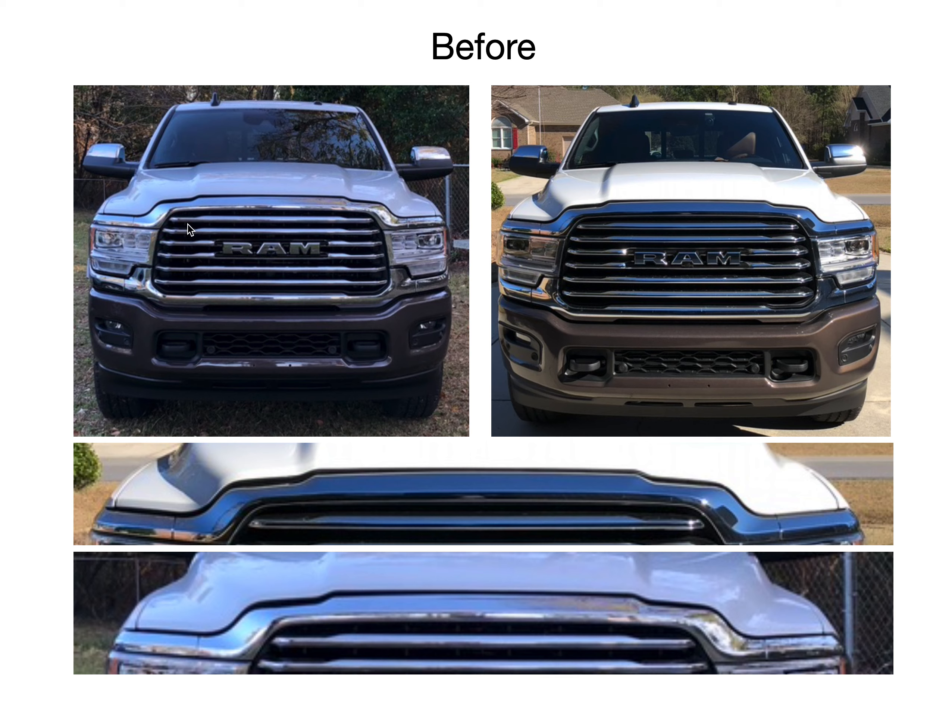So I had a tremendous amount of hood flutter because there's a huge gap and a lot of wind was able to get in under the hood and just lift it as I drove at highway speeds. Here's a better picture — you can see it's tight here, but as you move across there's a huge gap, particularly right here. The weather stripping and the top of the grille had no contact whatsoever. The difference between the bottom edge of the hood and the very top of the grille was over half an inch. That's a lot.